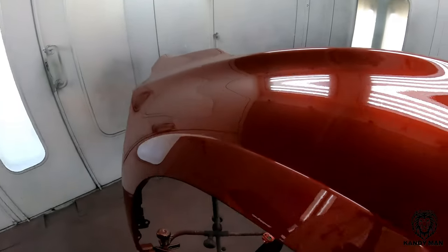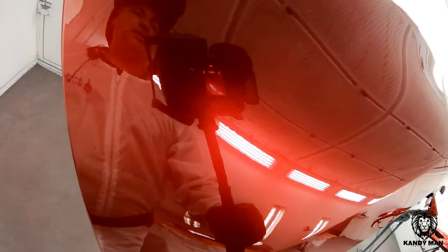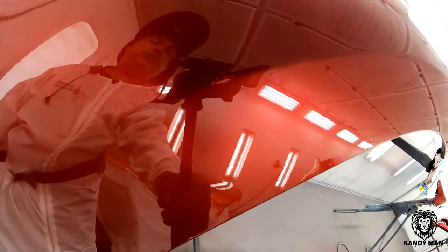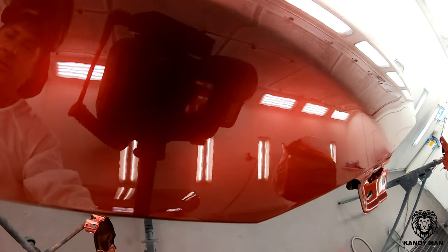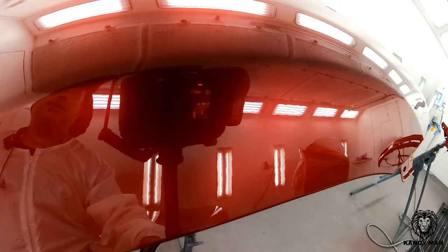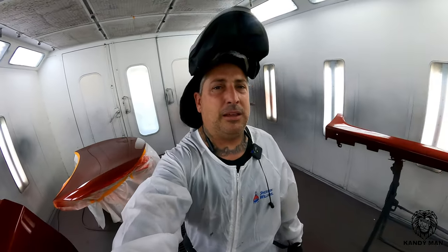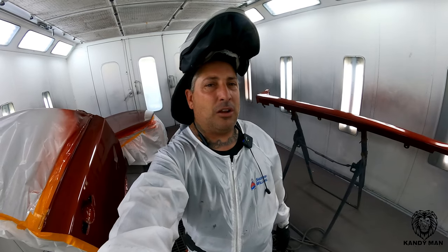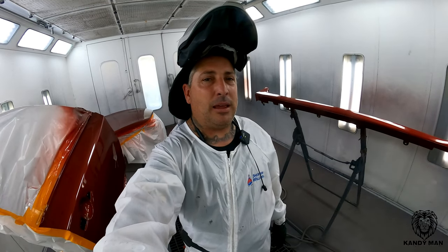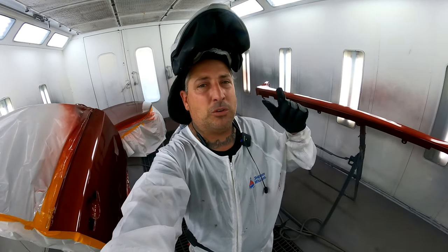This fender was sealed, based, and cleared fully — look at that nice factory texture that it has. It has just a little bit of peel in it that looks factory, and that's what I'm going for. We want these finishes to look like they haven't been done when we're doing these collision jobs. We don't want a dead giveaway — you don't want it too slick or too peely. You want that nice OEM factory look. Definitely a good gun, the LPH — I'm really happy with it and it's doing what I was hoping it would do. Hope you like this one, give it a thumbs up and we'll see you on the next one.